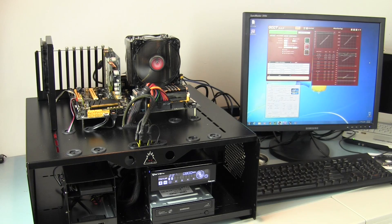Now that we have the TME3 mounted on a motherboard — the ASRock Z77 OC Formula — it also has 16GB of Avexir RAM at 1600 MHz with 9-9-9-24 timings. The video card is just a 7600 GT, something I had laying around for the test monitor. The power supply is an NZXT HALE 1000 watt, and the OS disk is an OCZ Vertex 3 120 gigabyte drive.